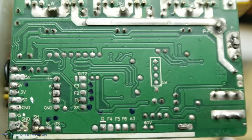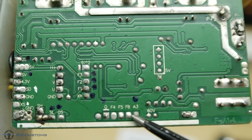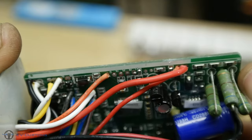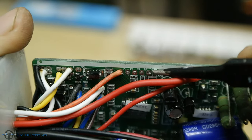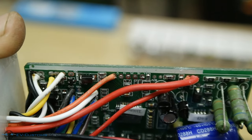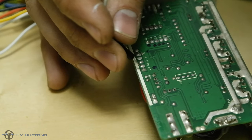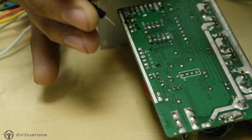brake. In my experience, 95% of BLDC controllers have this feature. And because I have done it too many times, and until now I cannot understand why most controllers didn't have this function wire, I will enable the EBS brake function manually from the PCB board for you guys, so you can do it yourself if you have a similar problem with your controller.